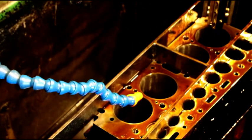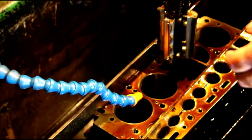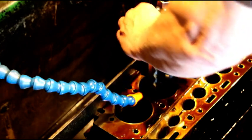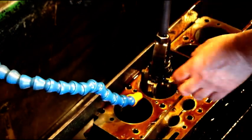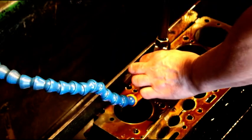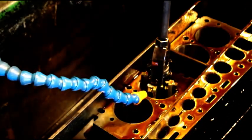Pistons, they say they hold half a thousandths. These, I measured all of them, and they got a discrepancy of about 8 ten thousandths. So you got to sneak up on the holes. Once you start fitting pistons, like I got 2 pistons already fit, you only got 2 to choose from. One's just 5 tenths smaller than the other, so we'll just fit it until we like it.